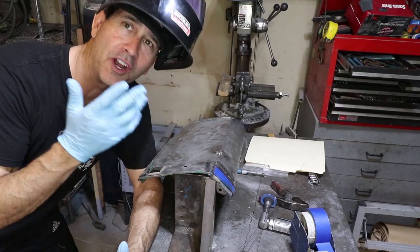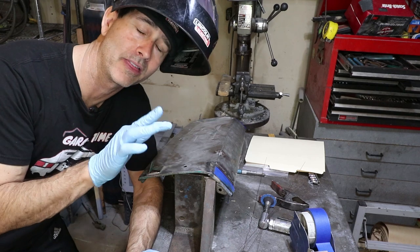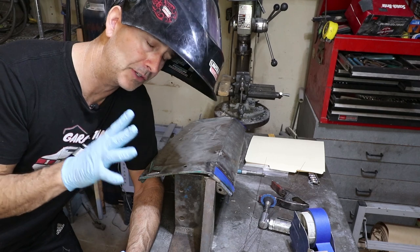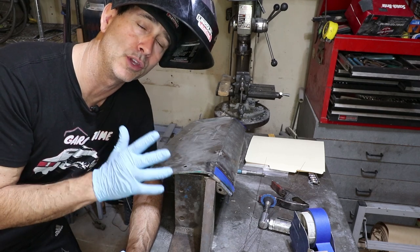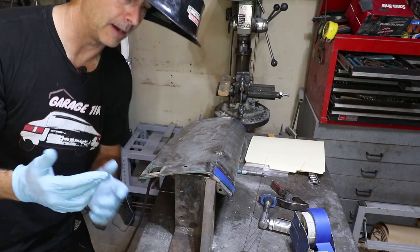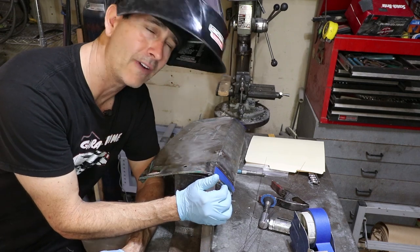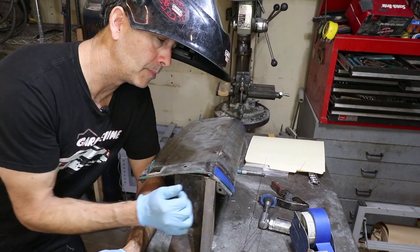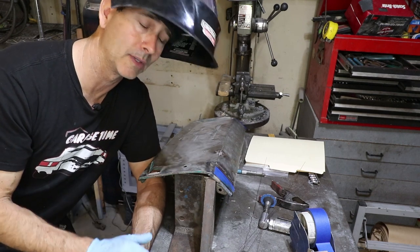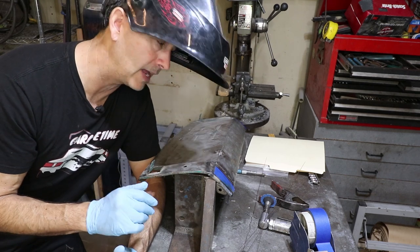I've had the question before, you know, sometimes I don't wear any gloves, and sometimes I wear these really thin, cheap Harbor Freight gloves, like 5 mil, 3 mil. These are really just for sun protection or UV protection. Obviously the arc creates UV rays. You don't wanna burn your skin, but this is pretty low amperage. I'm using 35 right here because it's on a corner, but a lot of times I'm only using like 20 and I don't push the pedal all the way down. So it's not a lot of energy, but you do want to prevent yourself from absorbing UV rays.